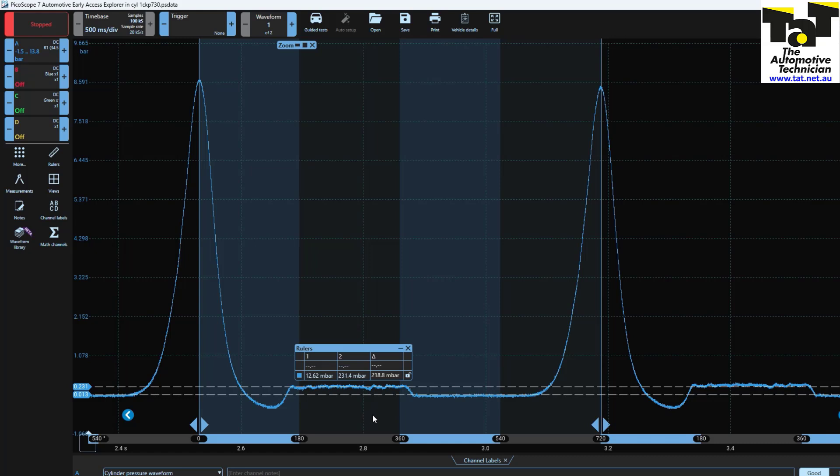Simple test — it was easy to get one of the plugs out, throw this in there, and we can get quite a bit of information from this: cranking compression, valve events, and obviously exhaust back pressure. It's a very interesting test and we're able to diagnose this fairly quickly. It's relatively inexpensive for the value you can get and the time you can save on certain tests. So hopefully that sparks a bit of interest for you guys. You can look for one — Pico's not the only one that does it, there's a few out there. Thanks for watching and we'll see you next time.